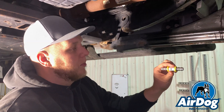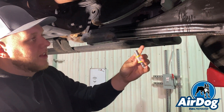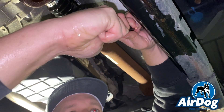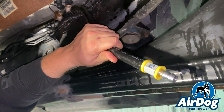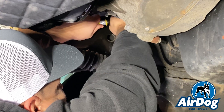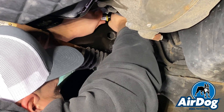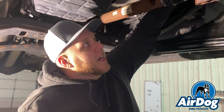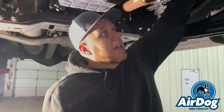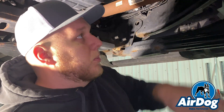We went ahead and wiped our mess up a little bit. Whenever you go to install this, you're going to want to oil these barbs. We're going to get this oiled up and press it into the side closest to the AirDog first. It was a little bit tough to get started being way up in there, but we got that fully seated and pressed in. This already has that 1/8-inch MPT port, so whenever you want to add an electronic sending unit later on down the road, you're already good to go with our Diesel RX fuel pressure splice.